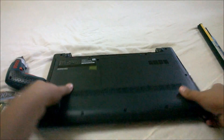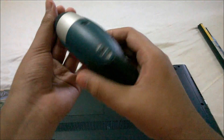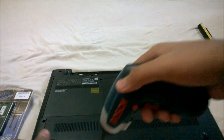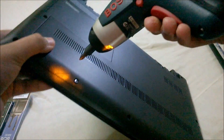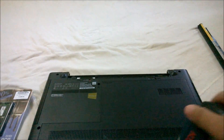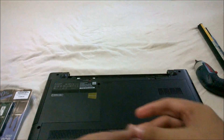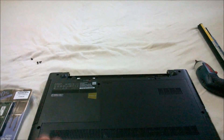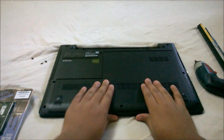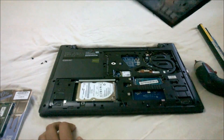Here there are three screws — one, two, and three. Take your screwdriver, press it on reverse mode, and put it in the screw hole. These three screws are very important, so keep them aside in a safe place. Then push the upper cover towards yourself, like this, and it will come out. Then push it upwards. This is the interior of the laptop.